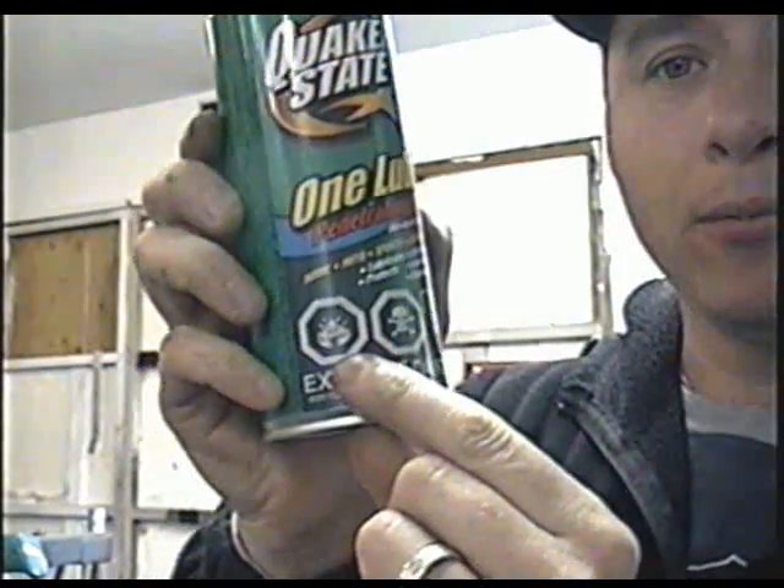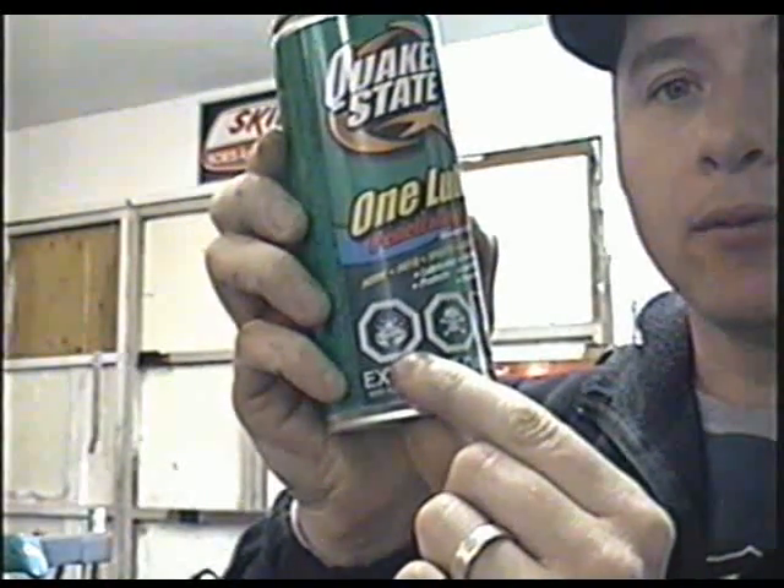If that doesn't work there could be deeper issues in the engine like timing, but what I just showed you is the easiest way to get started on repairing your lawnmower. I get a lot of questions about using Quaker State penetrating oil as a quick start substitute — the answer is yes, any penetrating oil will work. Just make sure it has the flammable logo on the can. I like using penetrating oil as quick start because a bit of oil goes into the engine when you start it up, which is especially good for two-cycle engines that require mixed oil and gas since there's no oil in a crankcase like a four-stroke. Thanks for watching and we'll see you next time.